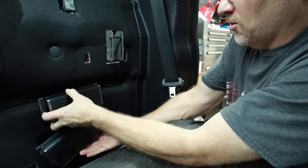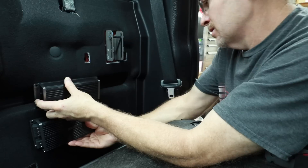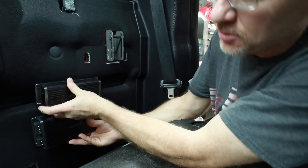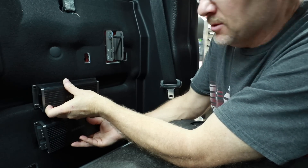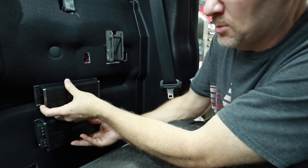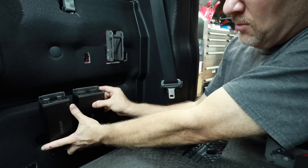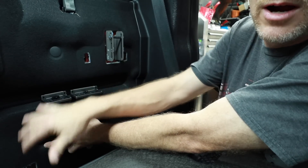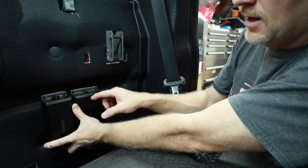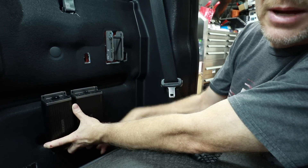We could also go sideways with them here and see the controls on this end as well. But think about where the signal is and how it's going to route — do you need to keep it away from your power? When placing amplifiers, I'm always thinking about which way the wires are going to route. The signals are here on this side, which is the total opposite of the power.